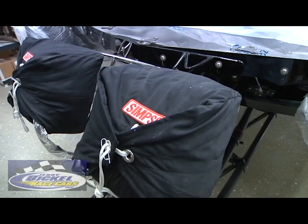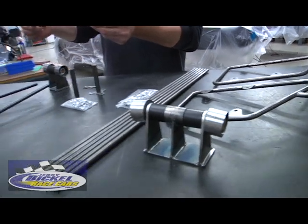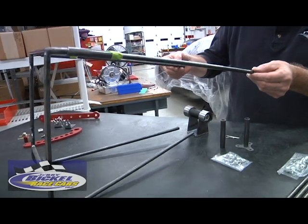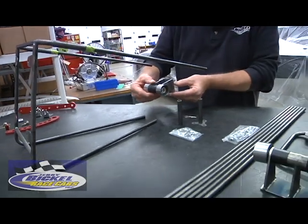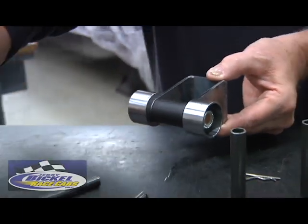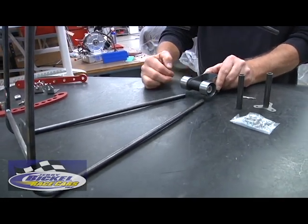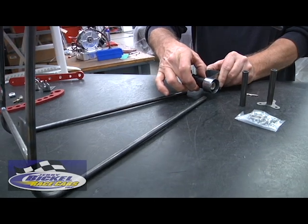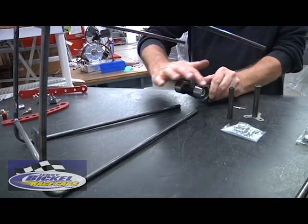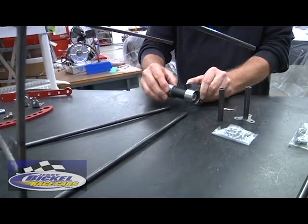What I've got set out here is our single and dual parachute pack mounts. This one being the single parachute pack mount — when you order from us, it comes fabricated in this stage. This is the cord pull point that would weld off of the rear of the chassis. These tubes would be cut to length and then welded to the cup washers on each side of the cord roller, shrouding the bolt and protecting it so none of the cord lines can get hung up on anything. Nice smooth surfaces — basically a continuation of the roller.